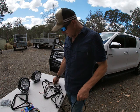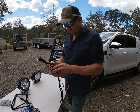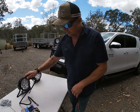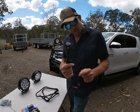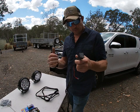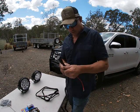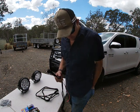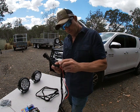So if you just start in one place, I've found, it's relatively easy to get going. The way I start is, I mount the lights, I put this cable onto the lights, then I mount this, which is the relay, and I mount that near the battery. I just screw right in, sometimes there's a bolt hole there, and there's your fuse. Tip for young players, take this fuse out first, all right? Keep it safe. That's a 25 amp blade fuse.